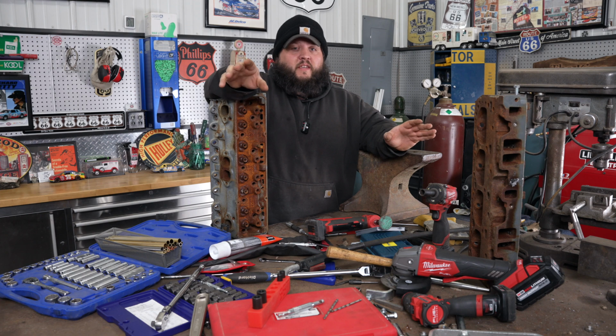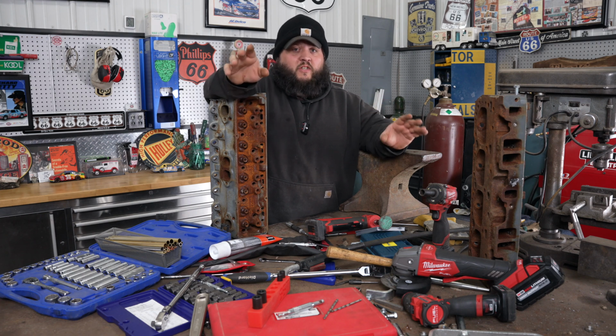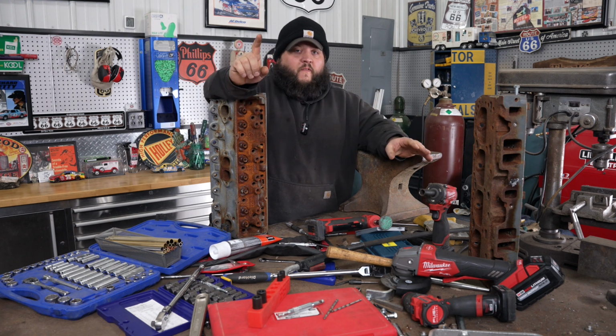To me, one of the best things you can do when it comes to drilling is drill all the way through the bolt. I think it helps relieve the stress in the bolt. When you're using my favorite style extractor, which are the rigids, if you can get all the way through, that is key for A, getting the bolt completely out, and B, getting the broken bolt off the extractor when you're done. If you can, drill all the way through. Just be careful what you're doing. You'll be able to feel when you bust through so you're not drilling into whatever part you're trying to save.